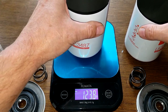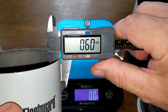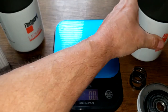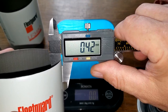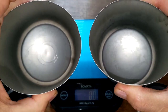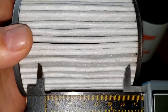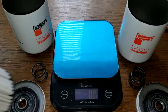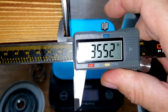The other can weighs 108.4 grams. The thicknesses: I was getting 0.44 millimeters thick for one and 0.42 millimeters thick for the other - slightly thinner but they feel the same. For filter media width, the 3487 is 3.66 inches wide and the 3313 is 3.55 inches wide.